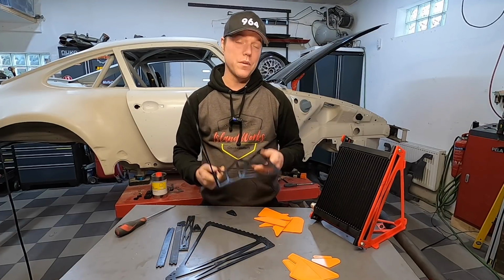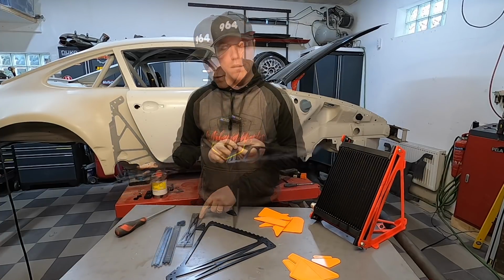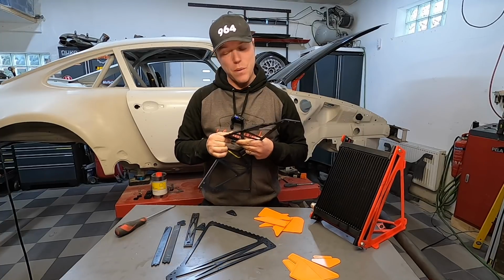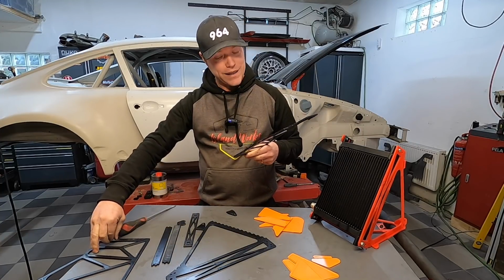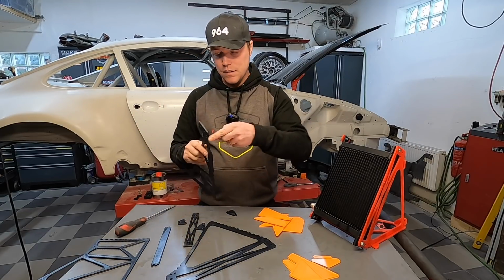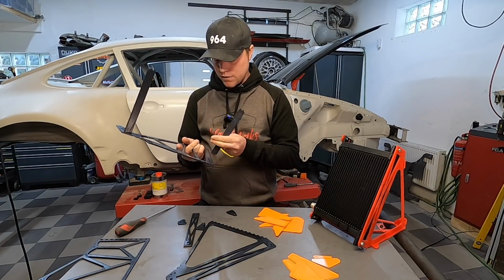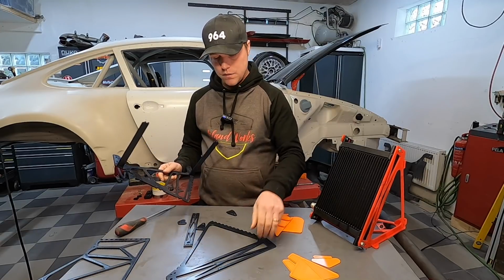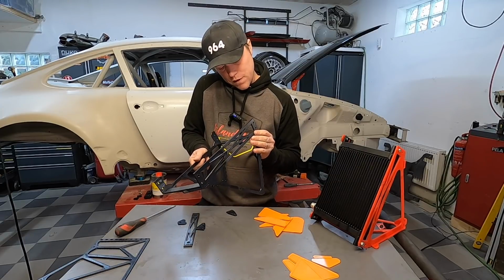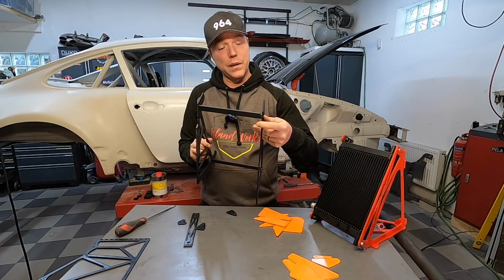The structure, the geometry, the shape is given by the slots and tabs. So this makes it really, really simple. This manufacturing technique, however, requires you to assemble it in the right order, because if you do this in a good way, then it becomes self-locking as well, which I have done in this case. So I need to assemble this in the right order, and as I assemble this in the right order, I can get this to fit together, and it will be self-locking, and the amount of welding that I need to do in the end will be really, really minimal.